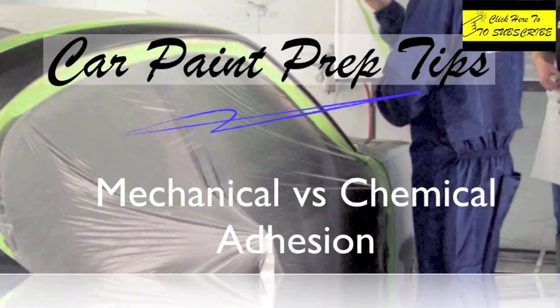And chemical adhesion is only going to last so long, and that's the window time. Once that's gone, your chemical adhesion, you don't have it anymore. You're going to have to provide mechanical. That's why we have to resand. So mechanical is produced by sanding. Chemical is a period of time you have where the chemicals will bond together.